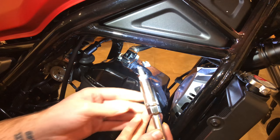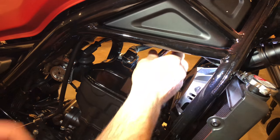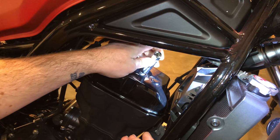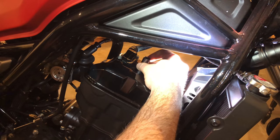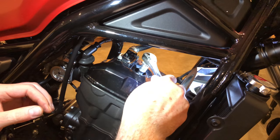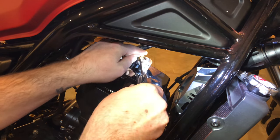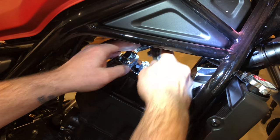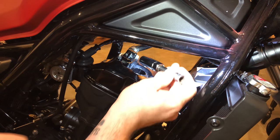To put the spark plug back in, just set it right there — but you can't get it in there because there's not enough room. So undo it, put the spark plug and the spark plug tool together and connect them. Then gently put it into the hole and start screwing it in. It's in all the way — just need to tighten it down. Remove the drive and remove the extension. Because the spark plug's not on there, it comes right out.